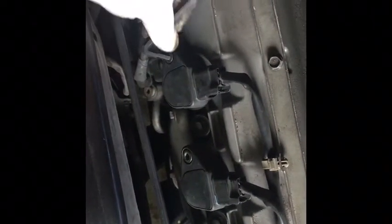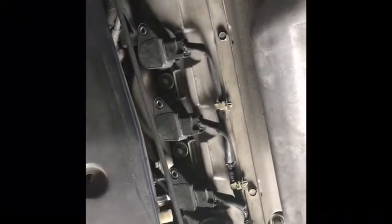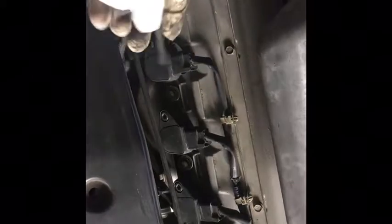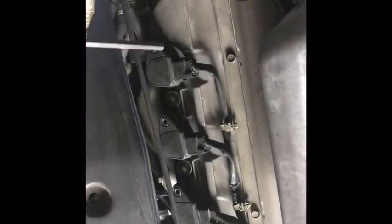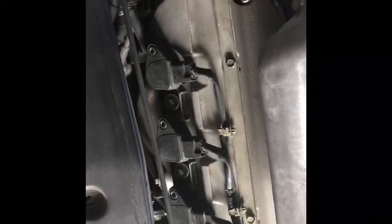You would need an Allen key, okay, which you would take these off one by one. Make sure you line them up here the way that they're put down so you don't mix them up. It's not good to mix them up since they're used to being in each cylinder. So once you do that, I'm going to show you how to remove each one, and then with a little trick that I've learned during the past, it's fairly easy, and then we'll continue. So what I'm going to do is I'm going to remove this Allen key right here.